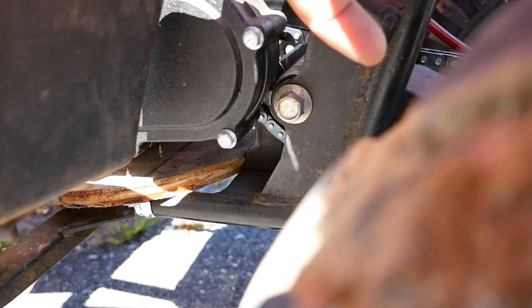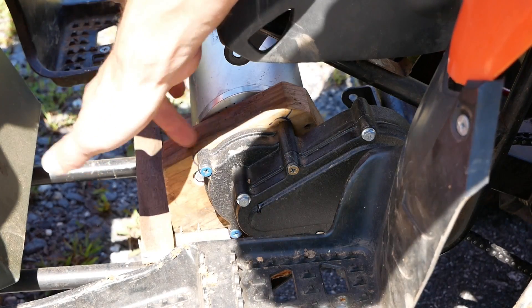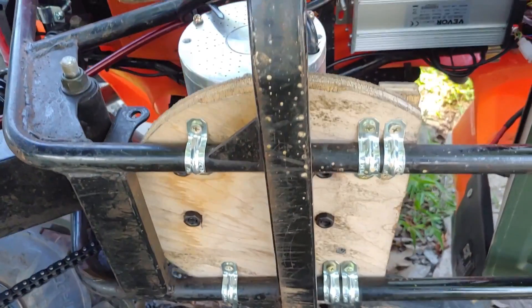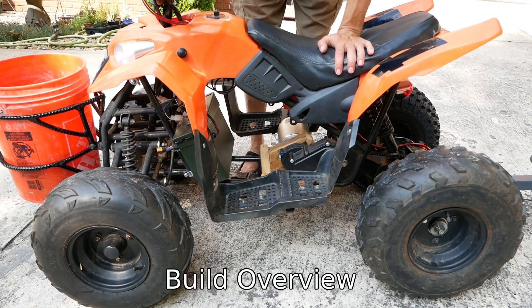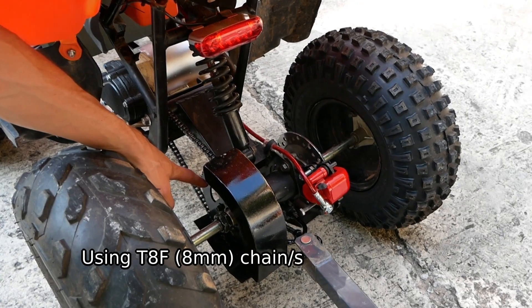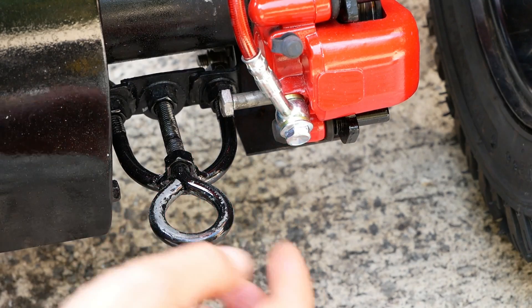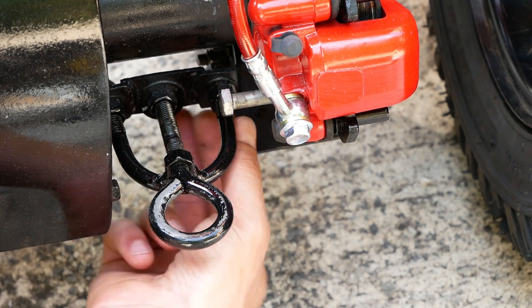When under high torque, the transmission cannot move in this direction. It's mounted by nothing except for four screws screwed right into a two-by-four using long wood screws. This allowed me to rotate the transmission to get the optimal angle for the chain driveline. I seriously used EMT pipe straps to attach the wood to the frame. I didn't change the chassis of the frame — all I added was a battery, a motor, and a gearbox. The sprocket is a totally different type for a different chain, so I wound up drilling holes to mount it. The hitch is merely an exhaust U-bolt and an I-bolt welded together, screwed into holes that used to house tensioning bolts that position the axle.